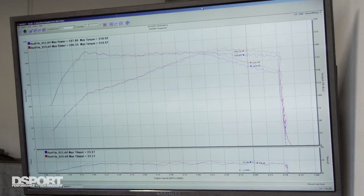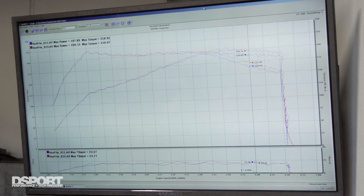We just finished the testing with the Mishimoto intake and the results are good — pretty much what we expected. The Mishimoto intake has actually added 10 horsepower at around 6,000 rpm, where the stock air filter was struggling to pass the required air needed for the increased amount of boost. The Mishimoto intake on top of the Honda reflash has given us 10 peak horsepower, and that's great.